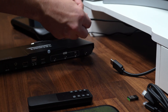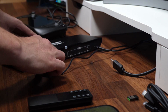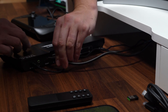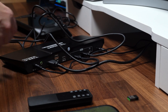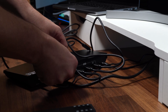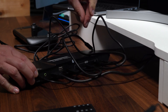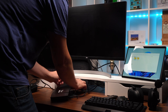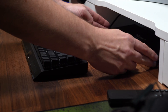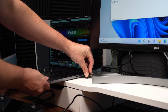I've set my desk up with my monitor, keyboard, and mouse to one side and I'm going to plug in my KVM switch. First I'm putting in the power for both the USB-powered device and the KVM's own power. I'm plugging my HDMI cable from my monitor straight into the device, then plugging in my three USB-C cables — making sure that the powered USB-C port 1 goes straight into my Steam Deck. I'm using one port for peripherals: my keyboard, mouse, and headset dongles all plug straight into this device. Then I push it back under my monitor riser stand and plug my remaining USB-C cables into my Surface Pro and my MacBook Pro — and we are up and running.